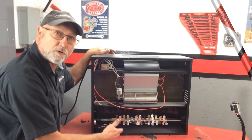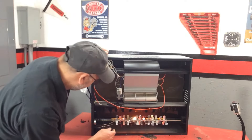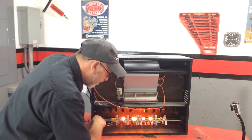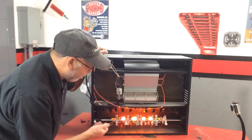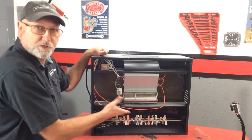This looks a lot like the one I had worked on in the past — you may have seen the video — and all I had to do was replace that motor. So I'm going to go ahead and plug it in just to see if maybe it's stripped or something, see if I can hear anything. The LEDs are on and that should be turning. More than likely it's probably that little motor right there. I'm going to pull that motor out, get the part number off it, and just order one, because there's nothing really that could go wrong other than that little motor. While I'm here I'm going to take the air hose and blow this all out, because the heater part still works — it's just the little flame that's not working.